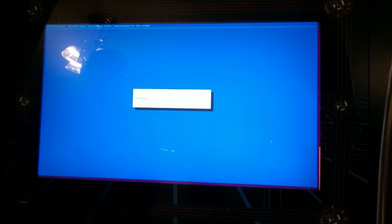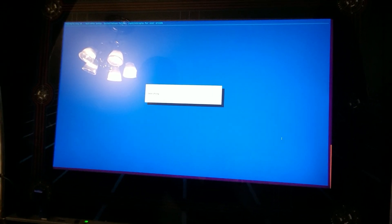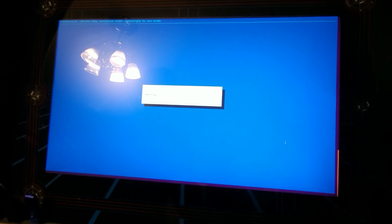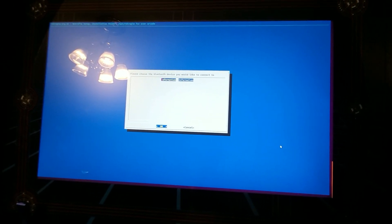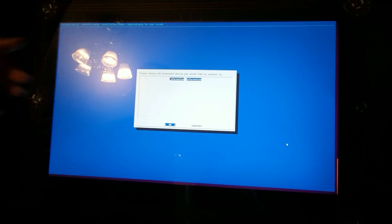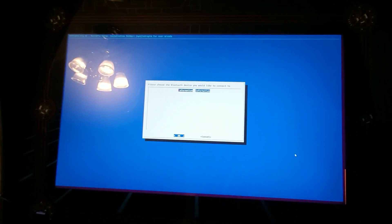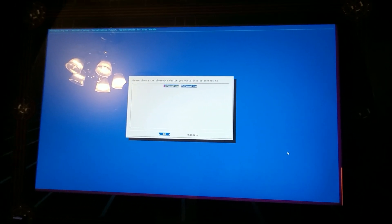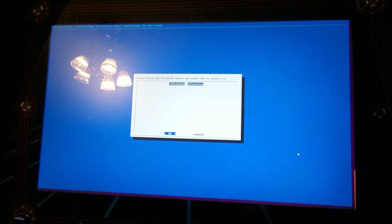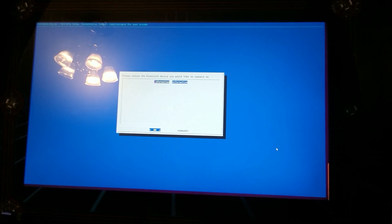Once you do that, they'll be blinking and you will come and say 'Register and Connect.' Once you hit A on 'Register and Connect,' it's going to search for it, find them, and you just click on it. Now this panel has two separate connections, unlike version one which just had one connection. It's not going to find them right now — I just wanted to show you. It will find your Bluetooth connection here, and you'd go down and click on it. It'll say something like 'Joypad One' or 'Joypad Two' and give you a MAC address, then you just connect it.